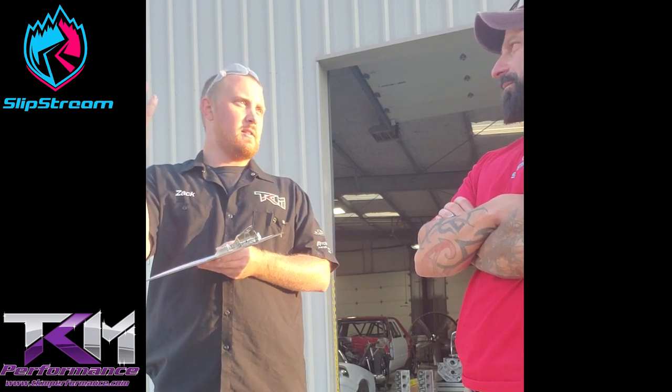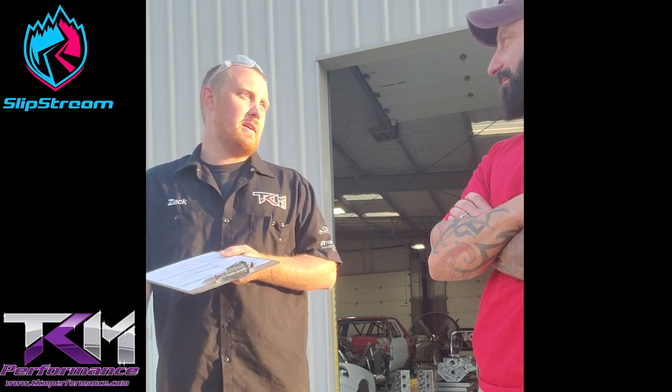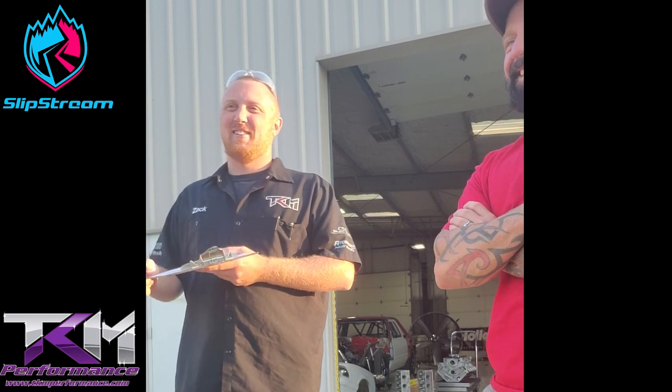So instead of O-rings, it's more... I saw in the Honda world, they just started welding a ring on there or something. So it's actual physical metal, right? Instead of an O-ring. Okay, yeah. We can go inside in a little bit and I'll show you everything. The top fuel hoop actually goes into the head. It's basically what they use in all the funny cars to hold all the boost. We're running, one car has seen 80 pounds of boost and hasn't blown a head gasket. My Honda couldn't do 40. So it's a big benefit of throwing hoops in that thing for sure. Yeah.